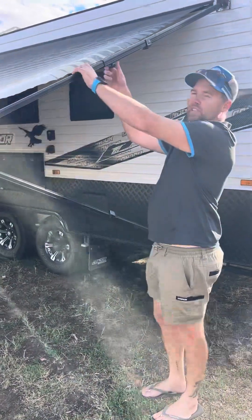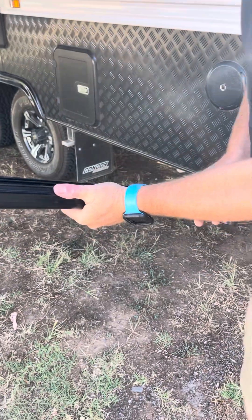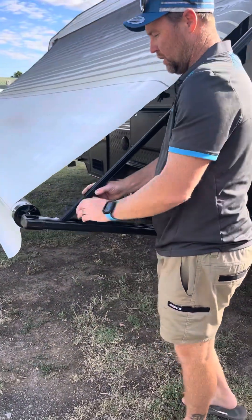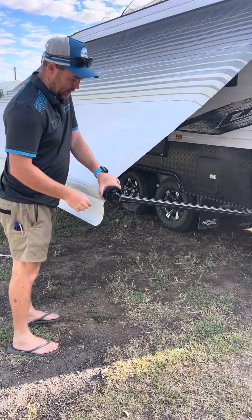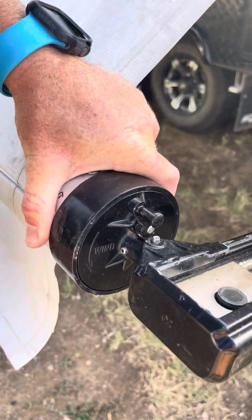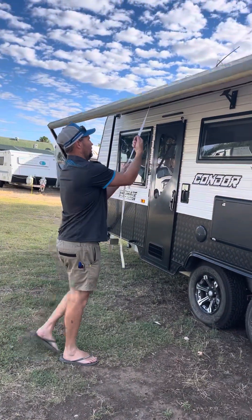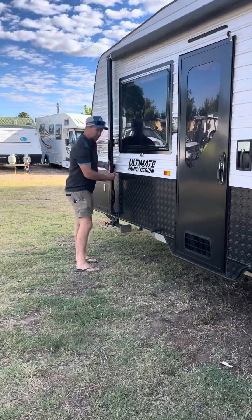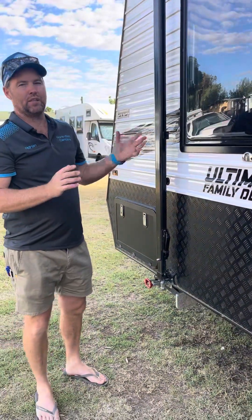To pack it away it's exactly the same process in reverse. To lower this, pull your black handle, get your trigger finger and just slightly lift up - that releases it and it pops down. Press that black button and your arm will slide all the way in. Then to fold it up, take that bit of pressure and flick that switch like we did at the start, then come over to your right - when it gets about a foot away just let it go. Then do your black turn knob up - you might just have to hold that arm in a little bit but it'll slide in. Do that both ends and it's all locked away. That's about it for our tour of the Condor - hope you enjoy your camping, thanks for watching.